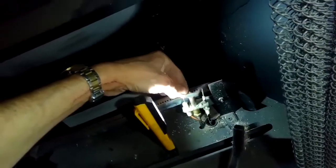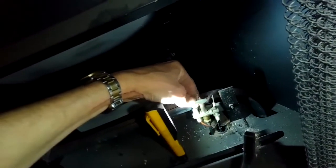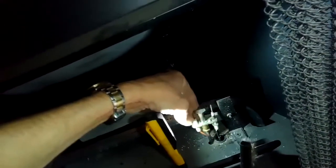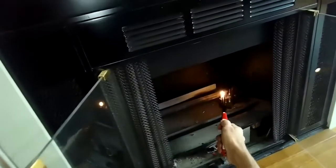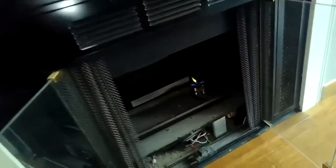Checking all these components, making sure they're tight. I bent the electrode a little bit closer to the hood just using my hands. I turn it on and get some spark going, but still no ignition — though it's a pretty good spark and I can hear the gas flowing. It wants to light, so I'm going to use an actual lighter to light it up. That's what it looks like when it's fired up.